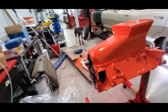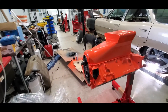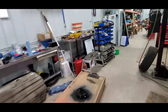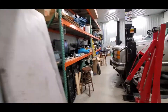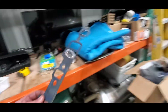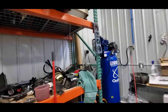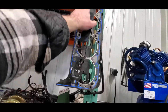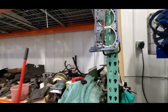I'm reasonably happy with where we're at. The short block coming back already assembled — that saved me a whole day of work. I did get gaskets ordered because we're going to need them. I always save gaskets that come off of something because we already know they did fit, so I can base my decisions on what was already there. However, you don't always want the exact same thing — I actually went to a different intake gasket. I don't care about crossover ports, but I really wanted to take advantage of the size in the head.